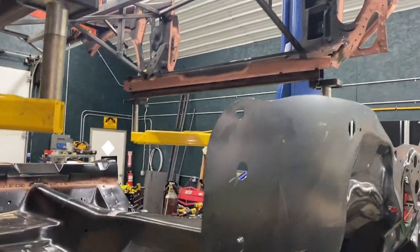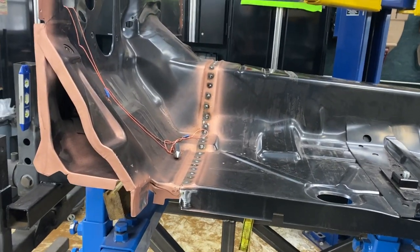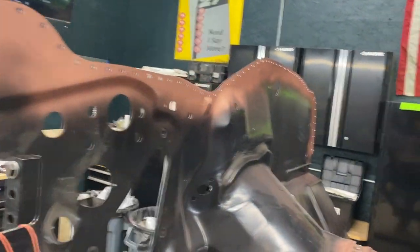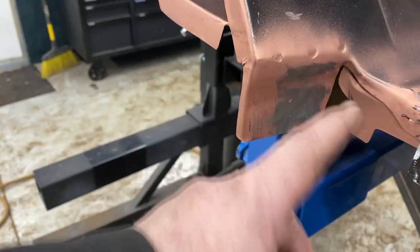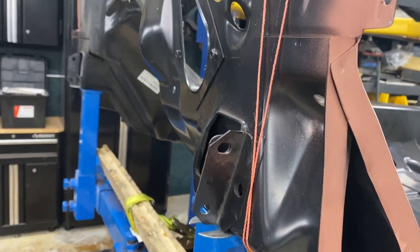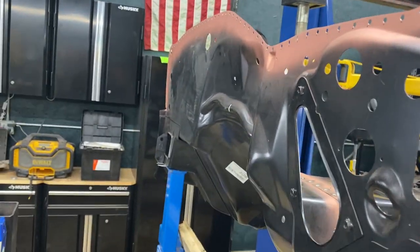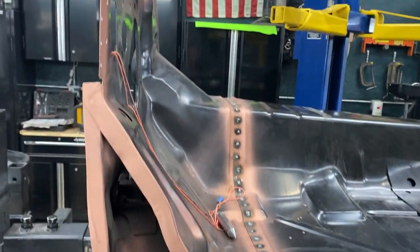Yeah, that's what I'm gonna start working on now. Firewall's back in, all prepped, holes punched — haven't punched these yet, I'm not sure where they've got to go exactly. Welded it up. I did manage to tilt it back a little bit with a very small shim — wasn't much, but I think it'll help. Now that part's done, some quality grinding time coming up.